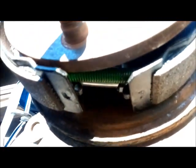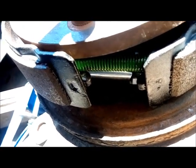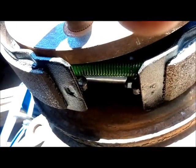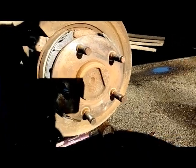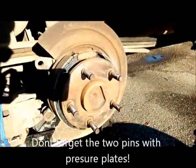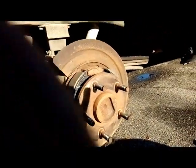Now we're going to move to the bottom. Next we'll put in our tensioner and our spring. You can see the adjuster and the bottom spring in place. After completing your two top springs, move down here — start with your adjuster, place that in, and then get the spring in. It's probably going to be a little tricky. Get one end in and just get the other end in — gravity was not on my side. But there you have it, it can be done. Now just go in reverse: place your rotors back on, calipers, and move to the other side.